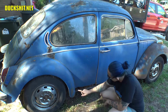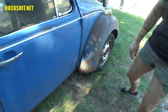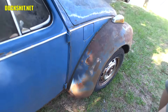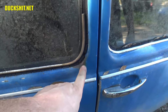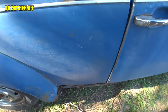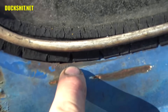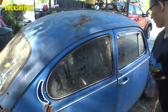We got a little bit of rust down there at the bottom that definitely needs to be addressed. Obviously the running board is also long gone — there are little pieces of it still remaining. That fender also looks a little worse for wear on the bottom. We're going to start following around the windows looking at the rubber seals. Looks like we got a little rust in this area — I can almost guarantee there is either a rusty spot here or a hole. That might be where the water got in at the bottom. Over here on the crescent vent, water definitely got in and went to the bottom, and it also looks like there might be a little pinhole right in here. This window is going to have to come out and I'm going to have to do some welding on the rear window area.